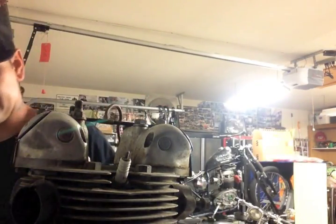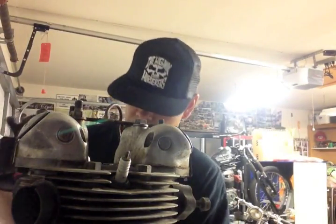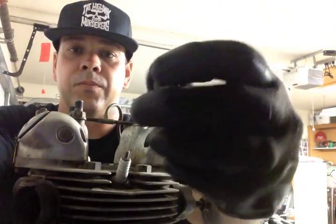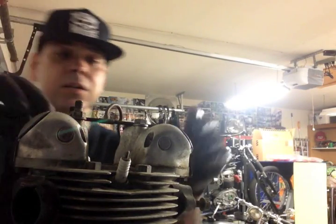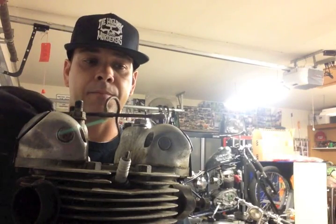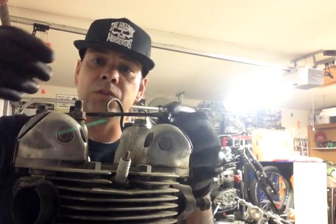Pictures are always nice as you take it apart so you can identify where everything went. Like these two nuts — they're probably the exact same size but one's a castle nut on top and one's just a regular round nut. One was in the front. If you're trying to do it exactly as it was, take a picture or have a photographic memory. There are also these nice little doodads under them — like a washer but it's a tab washer, some kind of locking steel washer.